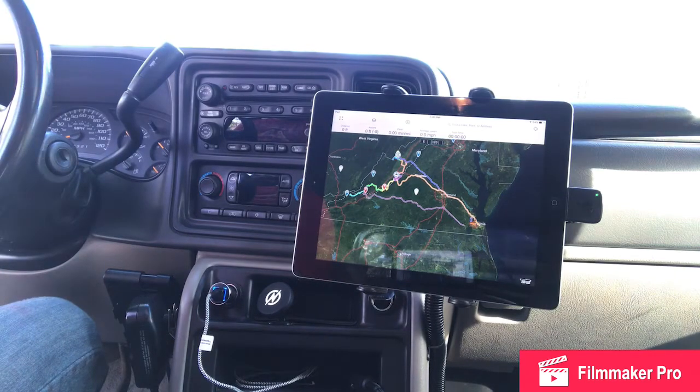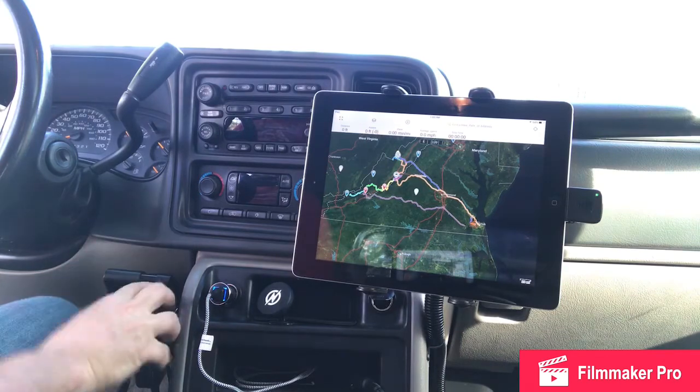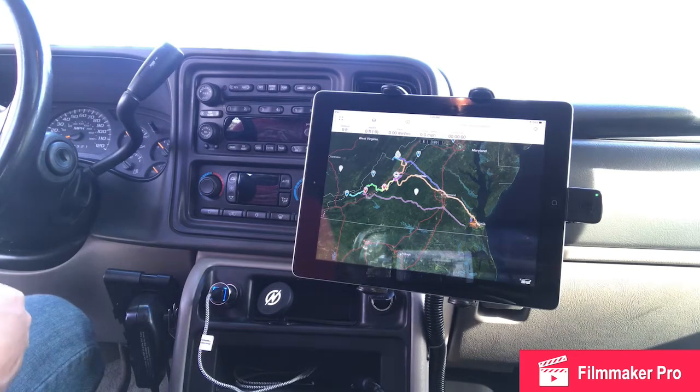The second aspect is communications on the trail. I currently use a CB — I'd like to upgrade eventually, but right now I have a Cobra handheld CB unit. It mounts right there, within hands' reach, easy to grab. All the wiring and coax is run underneath the carpet to the back of the cab and then up through the rear sail panels, attaching to the antenna on the roof. Pretty easy, very basic setup.